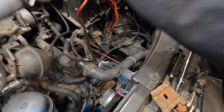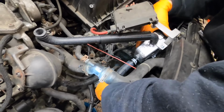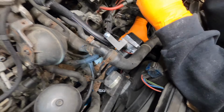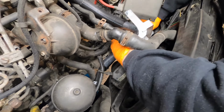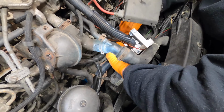Now you can take the Frostheater and drop it into the engine bay. It's going to sit just in front of the power steering hose, the metal line, and behind the cooling fans. There's just enough room for it there. You want to work it in so that the bottom coolant hose basically ends up where the oil cooler is, and the top hose is gently sitting on top of the wiring loom that's on top of the starter.